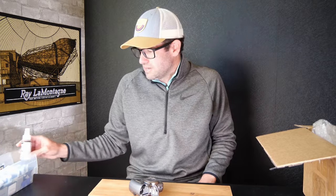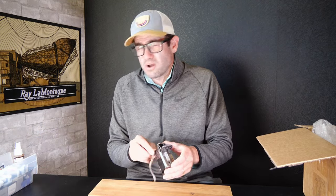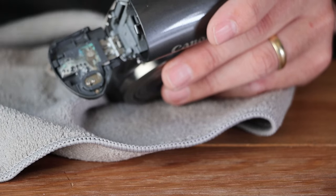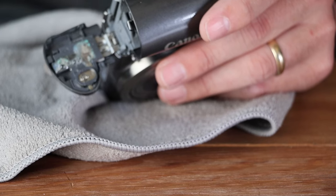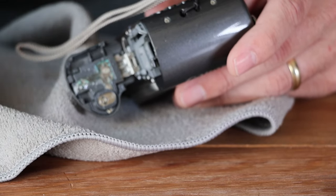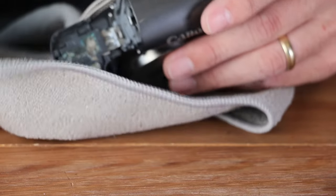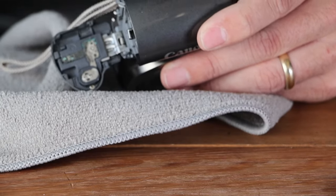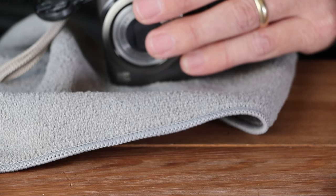I've got a little bit of vinegar here — regular white vinegar will work to get that corrosion off. I use either a nylon brush or wire brush depending on how bad the corrosion is. I'll spray a little bit of vinegar — see it bubble up? You don't want to overdo it because you'll get a lot of vinegar within the contact points and it'll make the camera smell bad. After this, if the camera is working, I'll clean that up with a different solution. I can see it got quite a bit of the corrosion off. Let me do a little wire brush cleanup and then throw some AA batteries in.